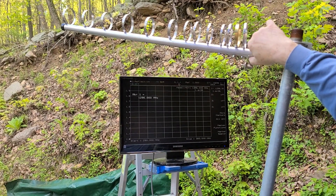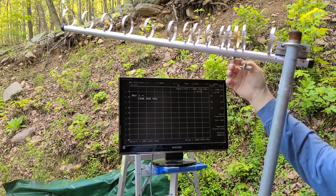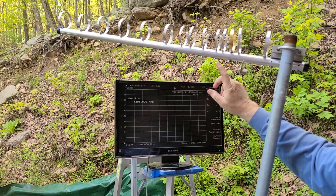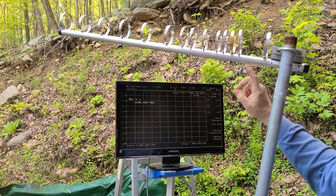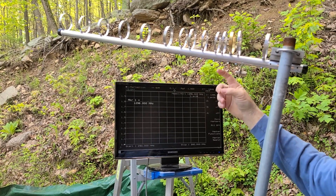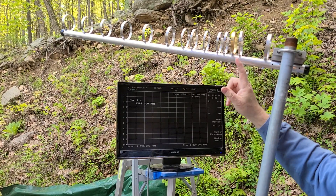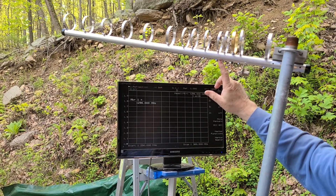If this was a front center-mounting antenna, the coax would bend forward. Whichever screw — either D1 or D2 — lines up with the hole in the connector bracket, use that screw. Just take the nut off, put the bracket on, and put the nut back on. Sometimes, depending upon how you had to shape the loop, the connector bracket may hit right in the middle.